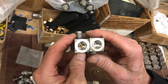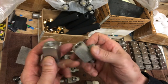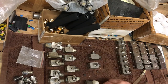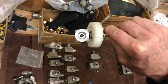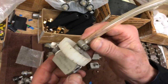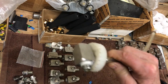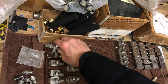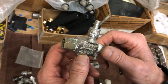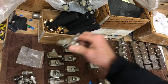Here's another nine and three of mine. Not that mine are holding up longer — mine need repair too. Look at these, totally shot. He goes back to the day when I was still providing a brass nozzle bushing. I've since gone to all stainless — stainless body and stainless nozzle bushing. I've even sent him a handful of stainless nozzle bushings to replace the ones he bought from me, but this one is still brass. See how the chemicals have eaten on it — this is a real problem. The draw tube's been worked on too, because I don't use screw clamps, I use Oetiker clamps. I'll be giving him a new draw tube and all quick change adapters.